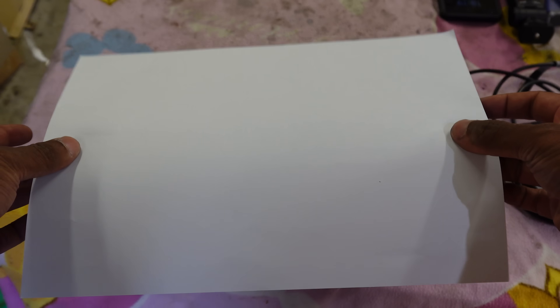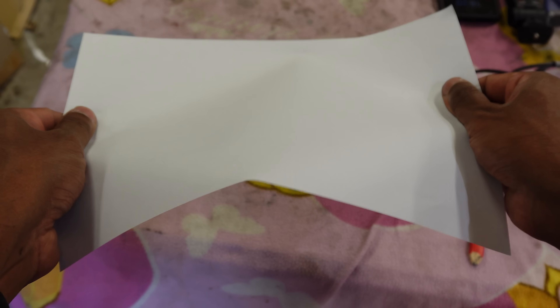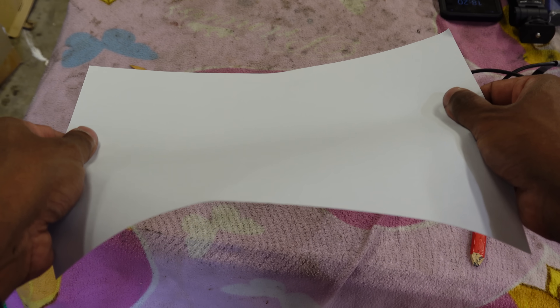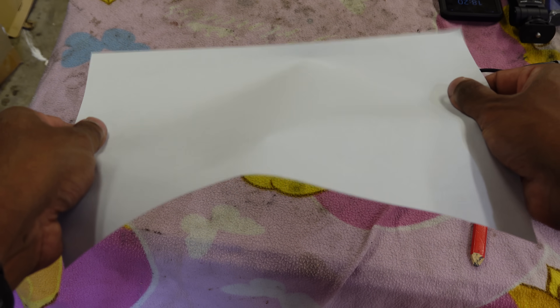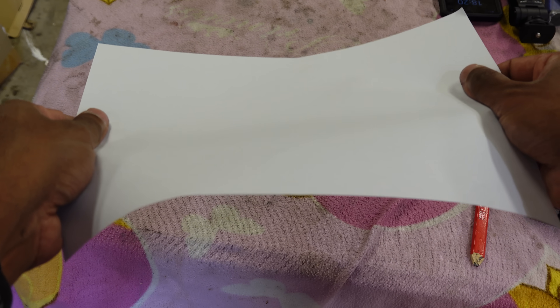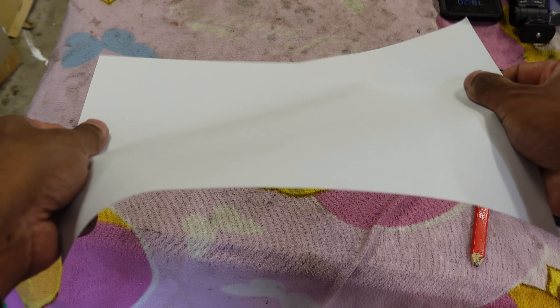Most metals and carbon fibre are very good in tension — this piece of paper represents a fibre; you try to pull it and it's strong in tension. However, in compression it tends to buckle, and that's what's happening in this bike frame. It is a thin section, so as you apply compressive pressure it buckles, and if you do it hard enough — even though this paper is flexible — it will just crack. And that's exactly what's happened here.